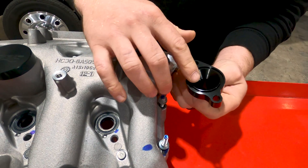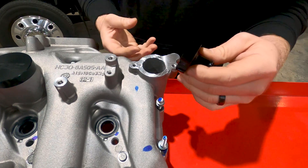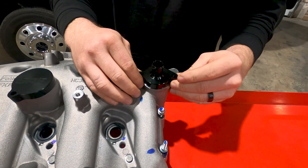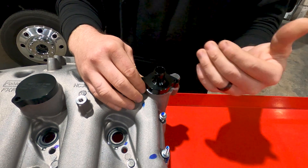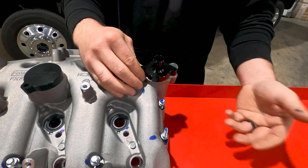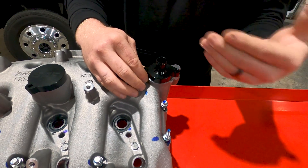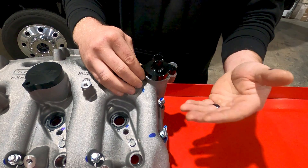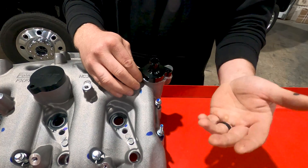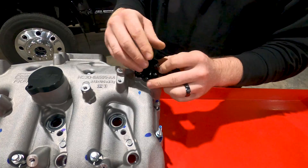The idea behind the Venturi is to allow oil vapor to kind of hit the wall as it's coming up through. It helps keep more of the oil vapor in the engine and not allowing it to escape, because the more oil vapor that gets into the tube, the more prone it's going to be to dripping. That is a common thing with this type of CCV reroute. If you are running a draft tube, it is possible to get a lot of oil buildup inside of the tube.